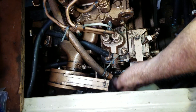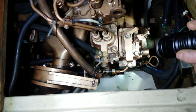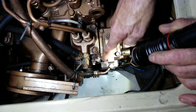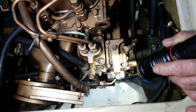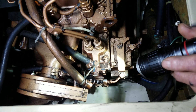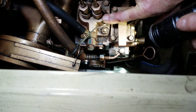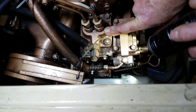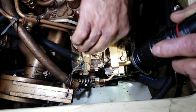Right here, this is the mechanical feed pump — the low pressure pump. It's got a little piston in it and it comes off the same cam that drives the injection pump — a lobe on it that drives that pump. It pumps fuel from the tank, through the filter, back to here to feed the injection pump. That's low pressure — I think it's six or eight PSI. This is the injection pump, and that pump below it is the feed pump, or low pressure pump.